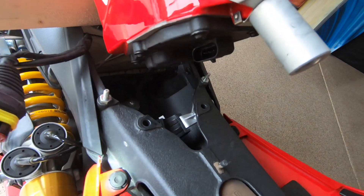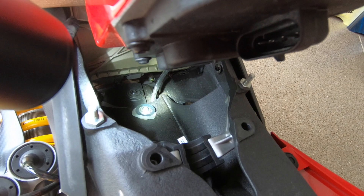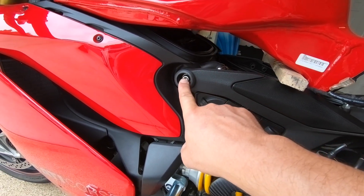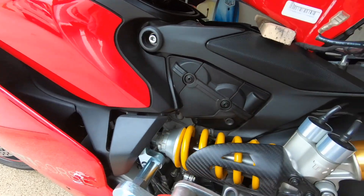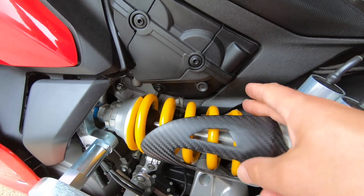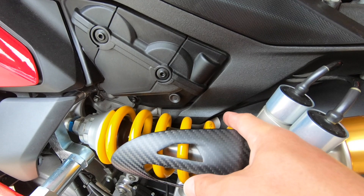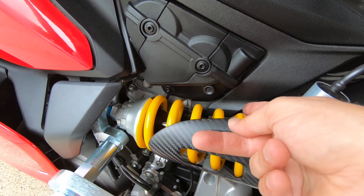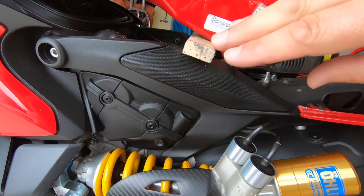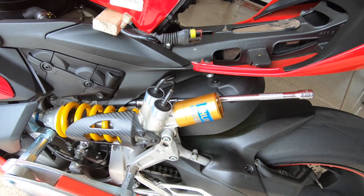The bolt you're going for here — I'll use a light to show you — is right underneath the tank. It's a 4mm Allen, with a bolt on each side at the top. We'll loosen these, and then there's a bolt down inside on the left side behind the shock and spring. That's a bit of a pain to get to. You'll need to remove both of these completely so this entire piece can rotate up and pivot on the back upper piece.